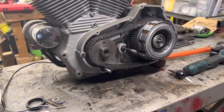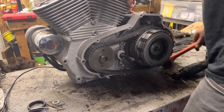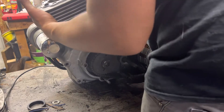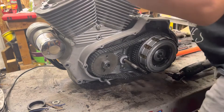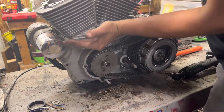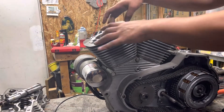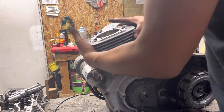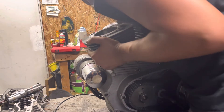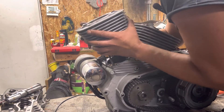I'm going to have to go through and re-put in that tensioner shoe the right way, with the spring actually applying pressure. On the cylinders, you've got studs that come up through this motor — those specialty bolts I was showing you are basically your head bolts. You've got steel studs that come up through the aluminum cylinder; those bolts sandwich the heads down onto the block. So your head studs essentially just pull down on these aluminum parts. We're going to pull these heads off real quick. I do have a brand new gasket set on the way as well.